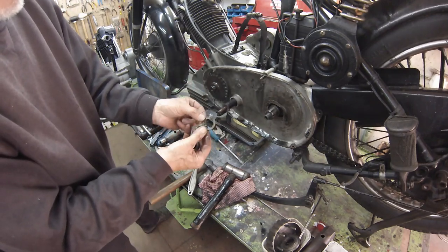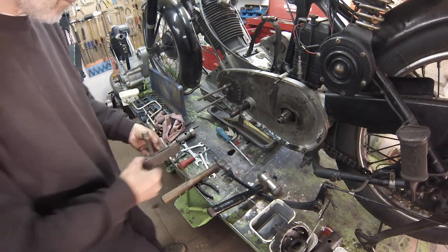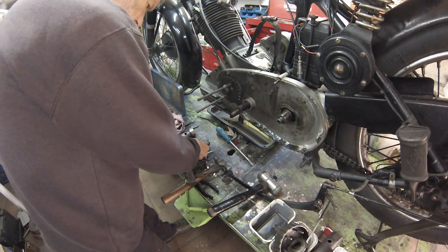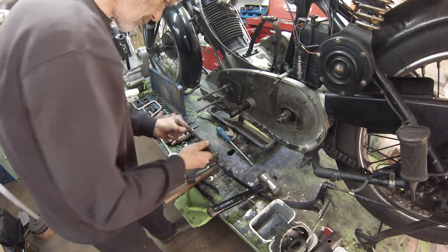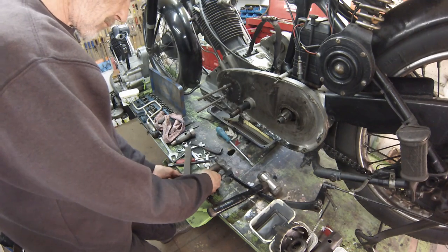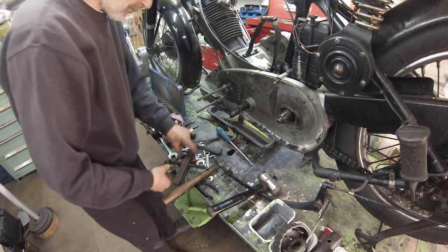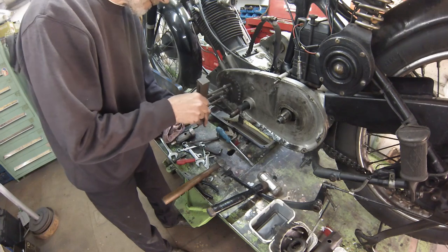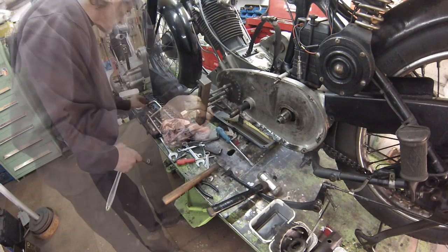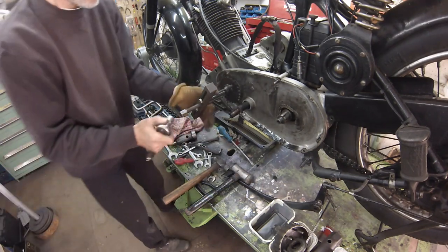A pneumatic spanner makes use of flywheel inertia to do the job, but you could wrap the sprocket with a length of drive chain attached to a lever, stuff a length of rope down the spark plug hole and bring the piston up to compression, or any one of a number of methods. We'll need that puller again to remove the sprocket, because it's very tight on the taper. A glove on the left hand is a wise precaution. Wait for it.